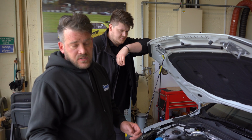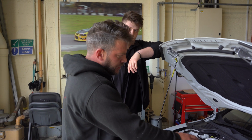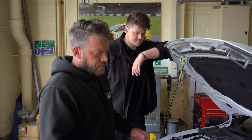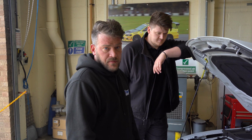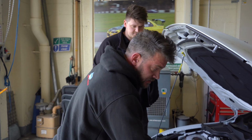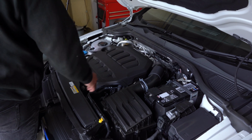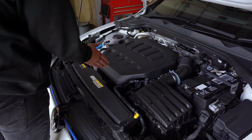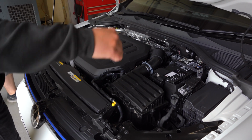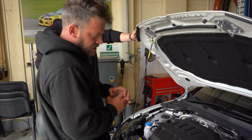As some of the enthusiasts know, the Golf R engine, the turbo's different. So we're certainly looking at that. We've got a right-hand drive version already in the pipeline. It won't be long before it'll be released. We're then going to be moving on to the dump valve. On this model it's not located in the turbo, it's a remote just before the throttle body. Be looking at the hot side of the turbo to the intercooler, trying to enlarge the boost tract there.